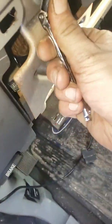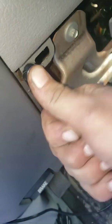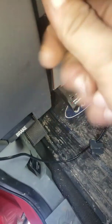Alright, I got that panel off. As you can see, the next bolt is right here in the corner, and then in this corner. These ones are actually going to be 8mm; the first ones are 7. Oh, nope, I'm hitting the wrong ones. I'm paying attention to the phone and this at the same time. So yes, 7mm black bolts, not the silver. Those are for the inner frame piece of your console, so you don't want to do that. We'll get this off. Quick and easy.